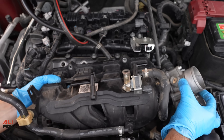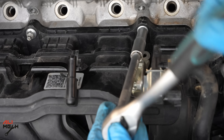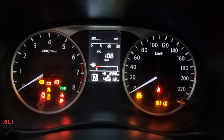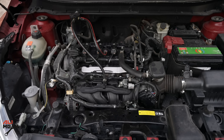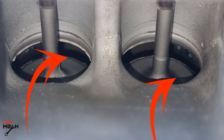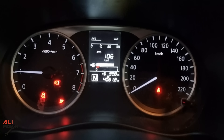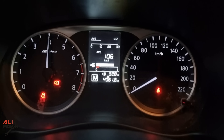Let's put it back, tightening all the bolts and torquing to the manufacturer spec. Starting it up, you will notice right away because we have better airflow now. Having carbon on the valves slows the airflow and also creates air turbulence. Even the throttle response is way better than before.